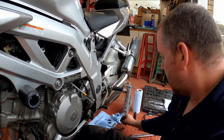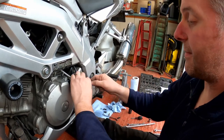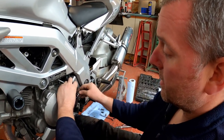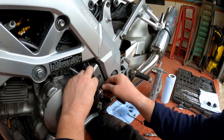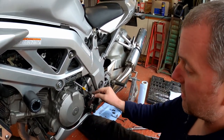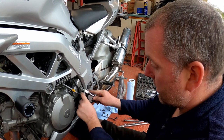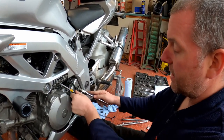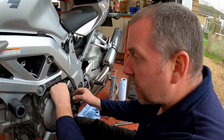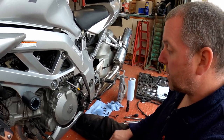What I'm going to do next is connect this end of the hose. I've got the brand new stainless banjo bolts that came in the kit and two copper washers which also came in the kit. Get her in position and bolt her up. I've got a six-sided socket - I want to use a six-sided socket because I'm less likely to mar the head of the bolt than I am with a 12 point. I'll give it a little nip up and that's probably going to be tight enough. We'll check for leaks when we come to bleeding. That's probably fine - now we need to move on to the handlebar end.